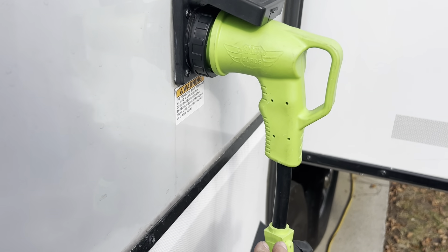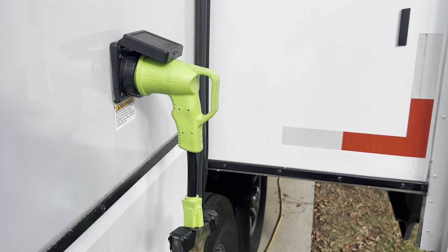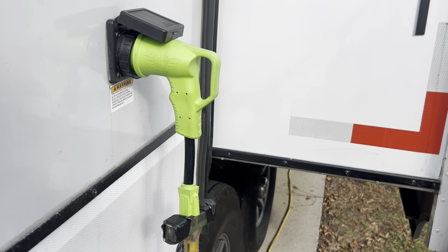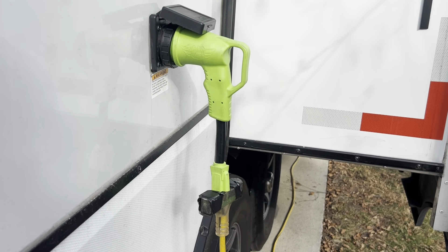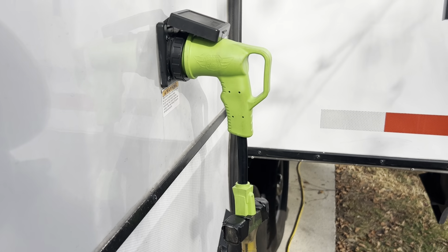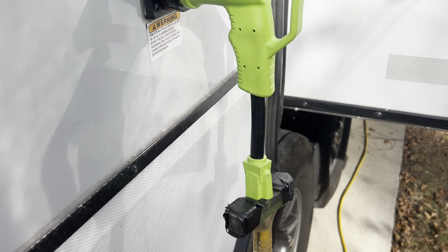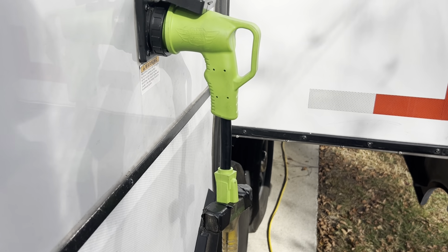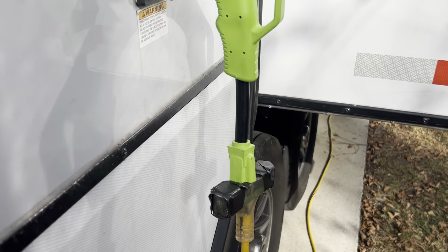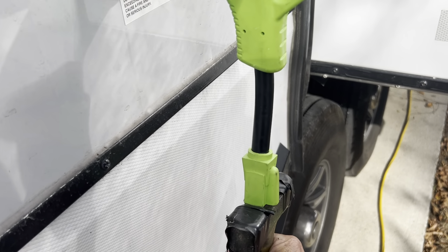This is not designed to plug up at a campground and run your microwave, heaters, furnace, and air conditioners. It's basically made just for what I mentioned — keep your refrigerator going, keep the batteries charged, run a couple lights, and possibly one air conditioner. It may work if you're mooch docking in somebody's backyard for a couple nights, but remember this is probably only rated to about a 20-amp circuit, which is probably all you'll be plugged into at a house anyway — maybe 30 amp — but you're limited to your extension cord size, so don't get crazy with it.